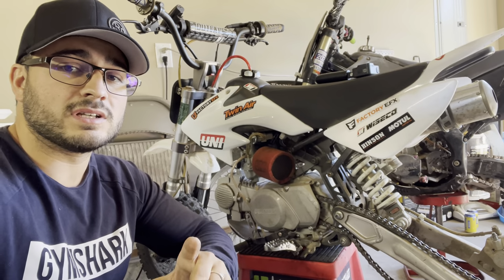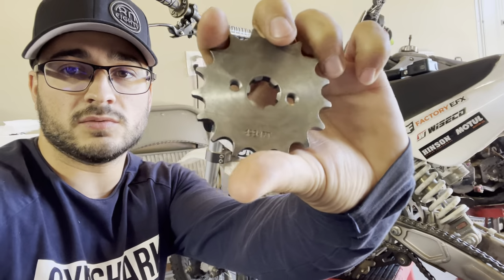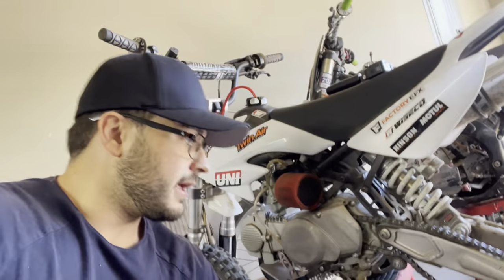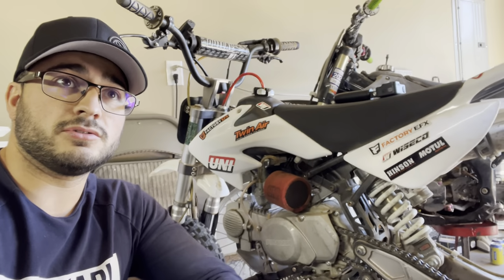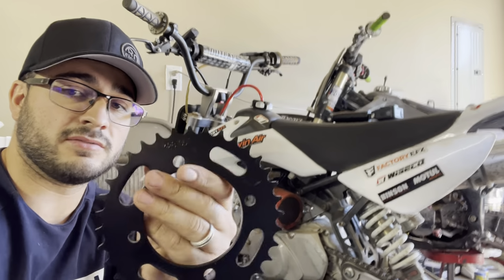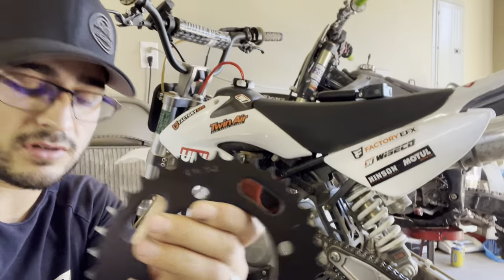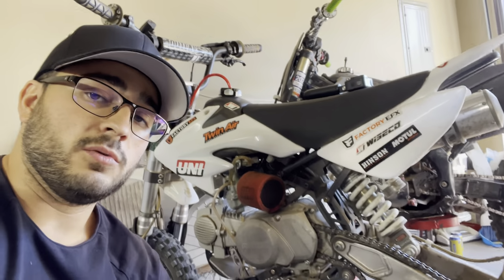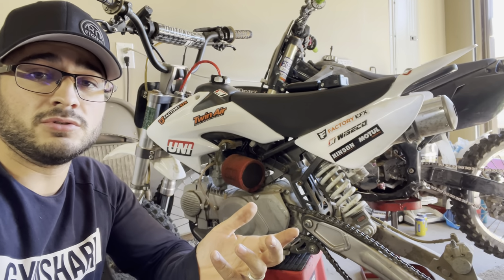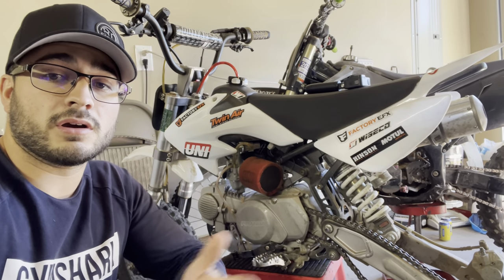One of the subscribers said if I changed out the sprocket on the front to a 17, which is what I got here, 17 tooth, 428 chain, and if I change out the rear sprocket to, I think he said a 33, I couldn't find a 33, but I did find a 35, and the numbers have to be both even or odd, that I would go about 70 miles an hour. Whether I'll go that fast or not, I don't know. It's a huge jump from 49 miles an hour to 70 miles an hour, but we're gonna find out.